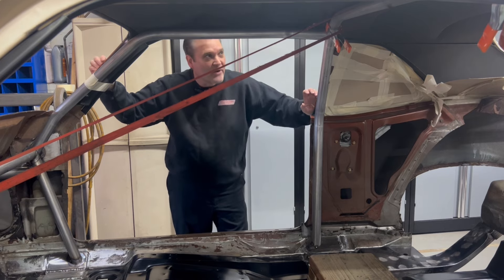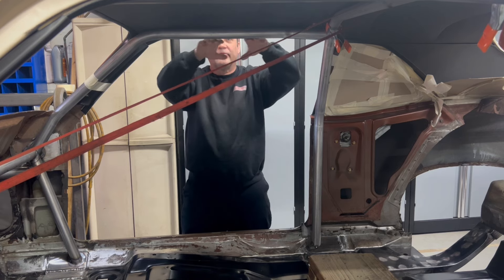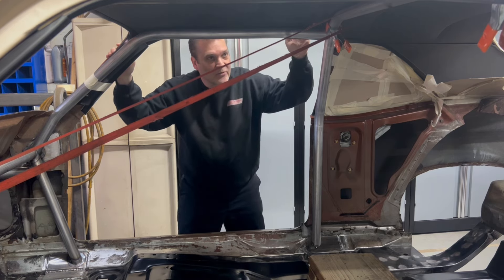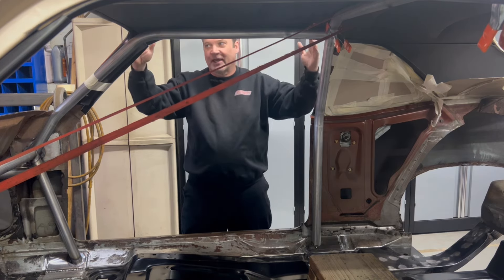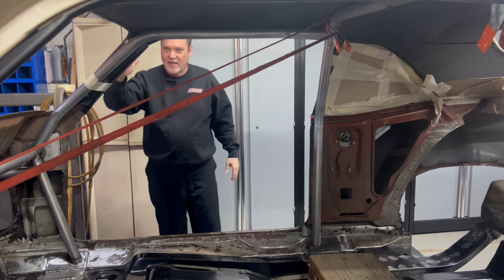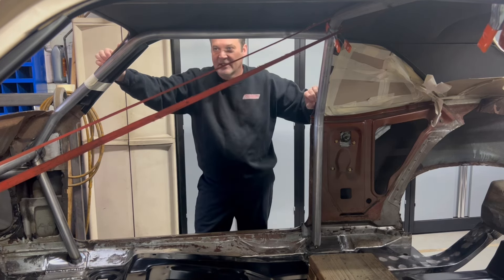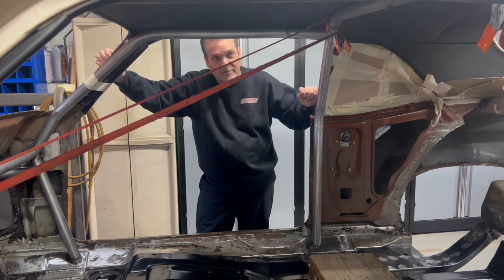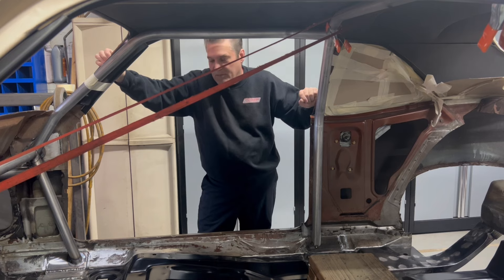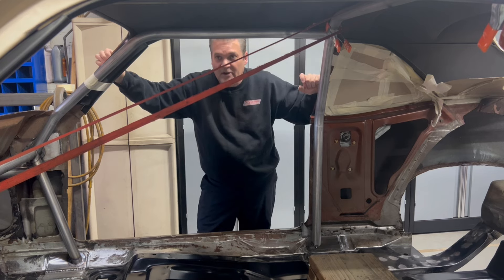So now I'm back over at the car and I've got the A-pillar bars up in there — they're just sitting there, I got them taped. What I wanted to show you is how this is perfectly in line with the bottom of the body. What's nice about that is if you're looking from the side of the car, you won't even see the roll cage. You look from the A-pillar, you don't see the roll cage; you look from the roof of the car, you don't even see the roll cage. That's how you know it's really tucked up in there and the builder did a nice job.